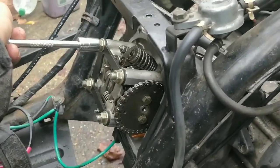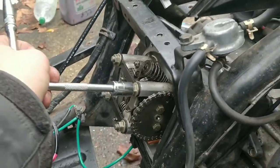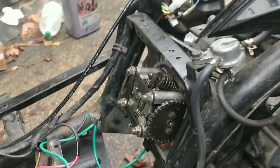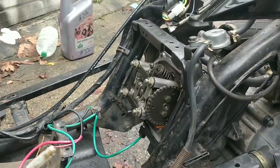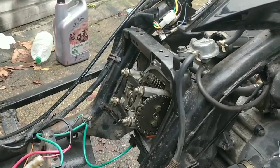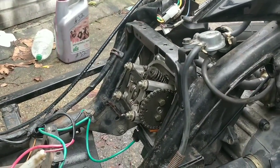So we go there. Look how I'm holding the ratchet. I'm not putting any pressure on it there, because at the moment we're just squashing the gaskets here. We're just seating the gaskets. Now I am going to put my two hands on it, but I'm still going to do quarter turn maximum. In fact, I'm not even going to do quarter turn, guys. I'm going to do half of a quarter turn, whatever that is.